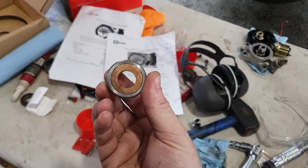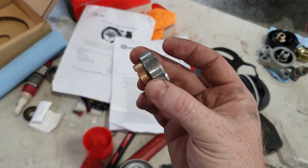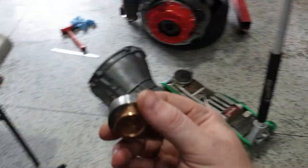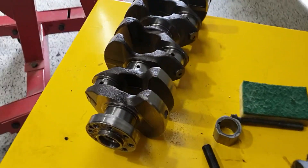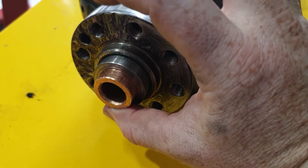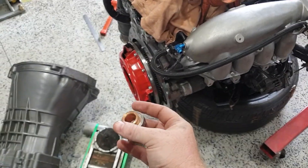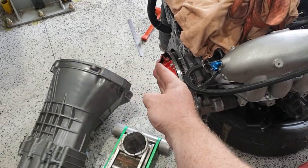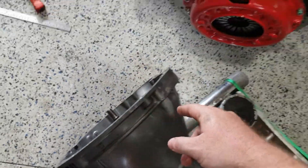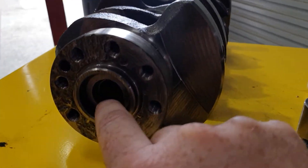This hand-drawn picture here shows a custom spigot bush that it comes with — and this is said spigot bush. It's a well put together piece. The marks on here are from me installing it with a socket, so that's not a reflection on the quality of work. You can see the subtle line showing how deep it sits into the SR20 crankshaft. It's installed into this recess here. The reason this exists is because the adapter plate, which is made of steel, is 10mm in thickness, which means it's going to move the gearbox effectively backwards 10mm, removing the engagement of the input shaft onto the original spigot bush.